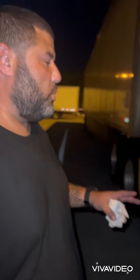Alright, fellas, so I put up a short video today about my air dryer that had issues, and I want to show you guys why it's so important, if your air dryer is not purging the air, like in my case. Sometimes they go bad where they just let all the air out, sometimes they just don't purge the air. I jumped on mine pretty quick, but mine was purging out of the emergency valve from the actual air tanks. I mentioned that it's not good to do that because then you have other issues. Let me show you what I'm going through right now.